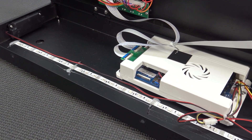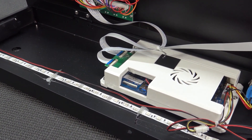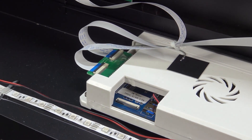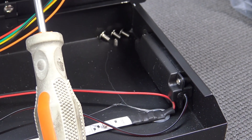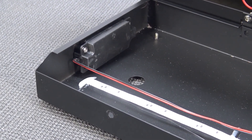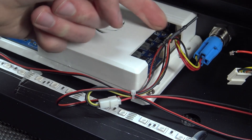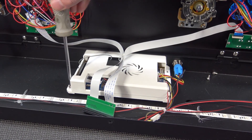Here we're having the gigantic LED strip that gives more like the cool RGB effect at the front. Here you can see we're having still the same EDA connection. What I find really interesting is that we're going to get two speakers inside the machine — one at the right and one at the left. But don't get me wrong, this is not stereo sound. They're doing a little bit of cheating here — basically soldering both cables together on the mono output pin. And on the other one, we're going to get the one for the on and off switch, and of course the power for the RGB strip.